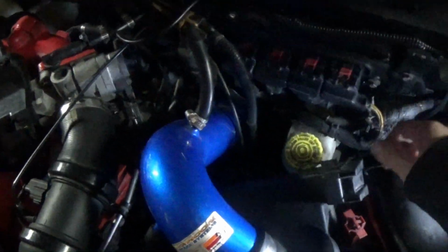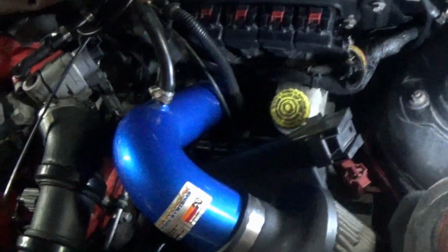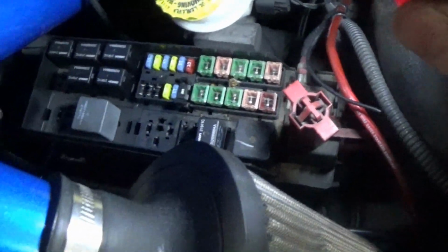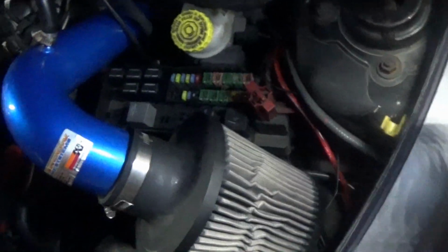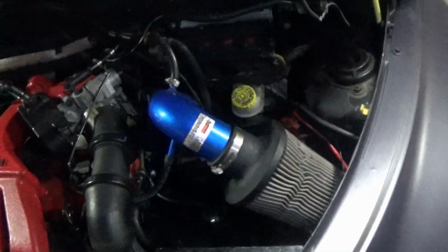Also, this wire was for my oil pressure gauge. It's literally not connected to anything, so just ignore that. I don't know why it came loose. I think our next step is to actually check every fuse. I have pulled every fuse out on my own time and tried to see if any of them were the problem, but I had no luck. I might have to grab a tester first thing in the morning, and we'll try to test them all. This is, I think, a good way to continue our search, assuming that that is our problem.